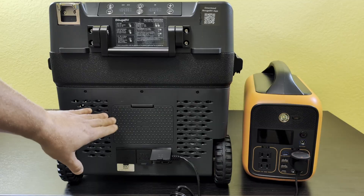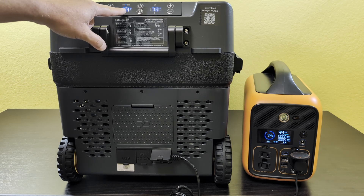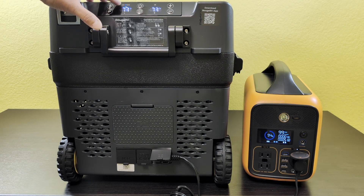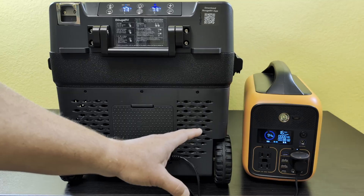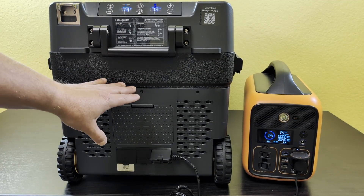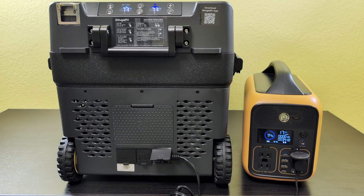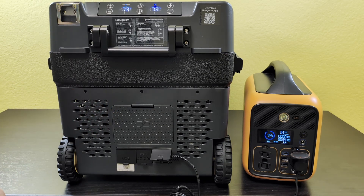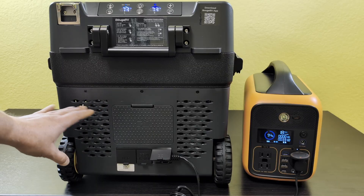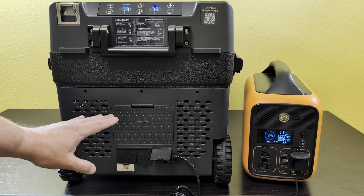You can just use a power station. It's starting to power up — as you can see here it's saying 73 degrees and it's on max. This would be green if it were on eco, but it is white, showing it's on max mode. It was running at about 5 watts with just the LEDs and standby, and now the compressor has kicked on. I hear the fan running, and it's pulling 35 watts of power. I think it's going to pull more than that — it's just starting up. Although it's very quiet, I do believe the compressor is actually running because I hear a tiny bit of a gurgling sound, but these things are extremely quiet.